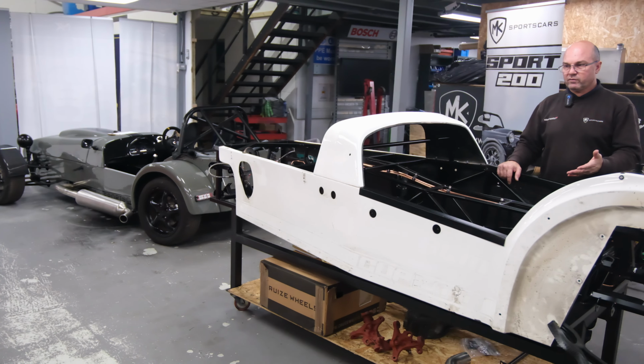But anyway, lapping the valves in there, and it's got everything out on the bench, getting that all nicely done and shimmed up accordingly. And then we're putting a new timing belt on it. So it's a new water pump at the same time, which we've got down here ready to go on. And we are going to shim the oil pump to give it a little bit more oil pressure. But that's just a little shim that goes behind.